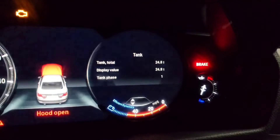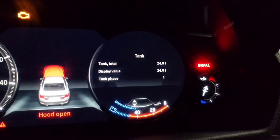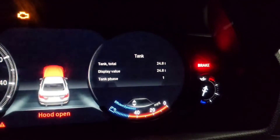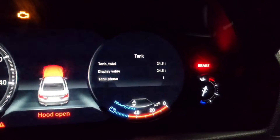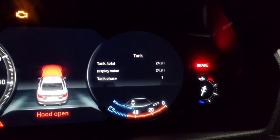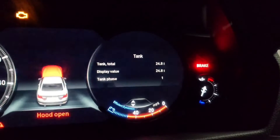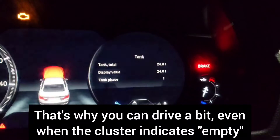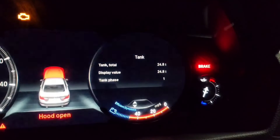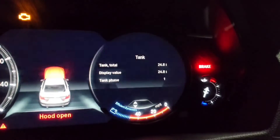The next thing you want to do is fill up your tank with premium fuel and check that number again. Get back into the hidden menu and you'll see what it maxes out at. Mine maxes out at 55 liters, which is about 14.5 gallons. That tells me it ignores the extra roughly one gallon of fuel reserve, since my tank is actually 15.5 gallons. So fill up with 93 or 91 octane and check what the display value maxes out at — that's the fuel tank size value you'll enter into your ethanol calculator app.